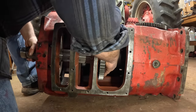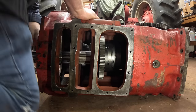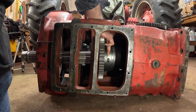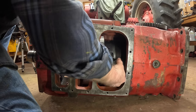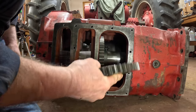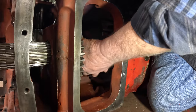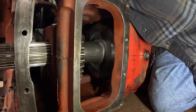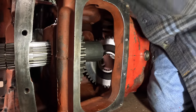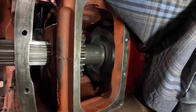The gear needs some convincing - I'll tap it on with a rubber mallet. The spacer goes on next, then the direct drive gear goes in. Maneuver the gear around to where it's supposed to be and slide the counter shaft back to catch the gear. Have the gear fall off and do it all over again. It's through.